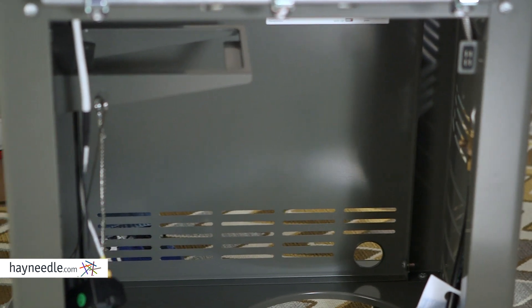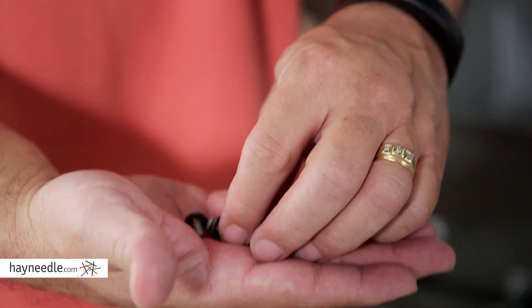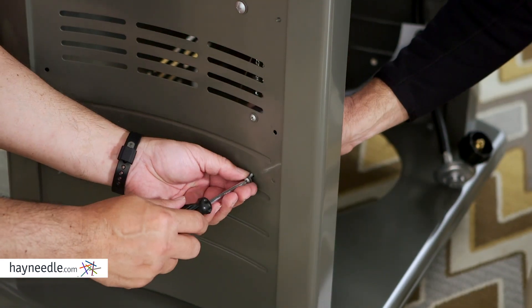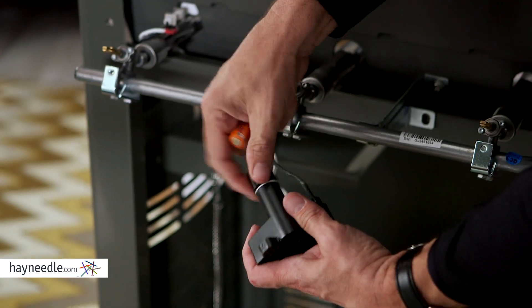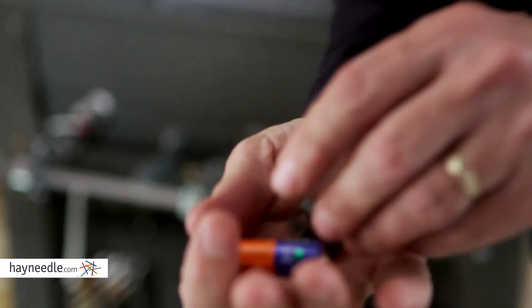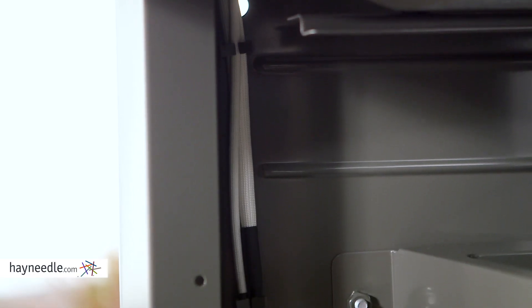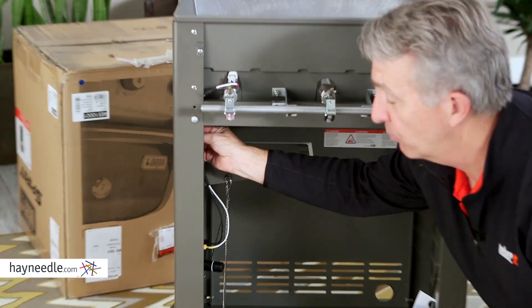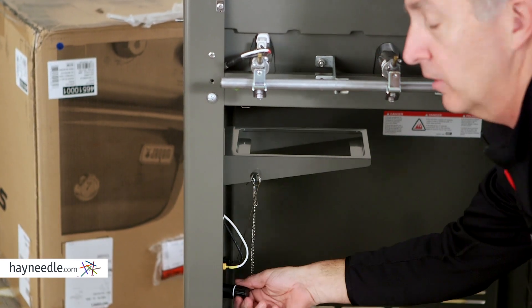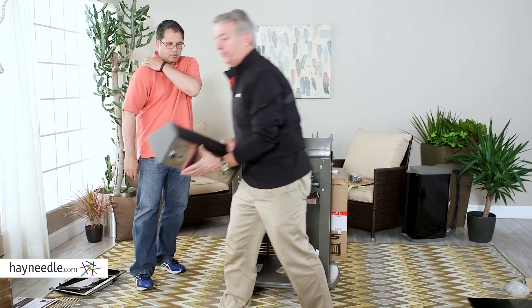On the other side, we're going to mount the igniter using parts from packet D. That packet includes two small screws that hold the igniter into the wall, and the battery that's included. There are also two little gray clips that go inside the grill — this is where the white cable clips in so it stays out of the way when you open the door. Tuck the white electric wire into the gray clips, then insert the battery with the positive side sticking out.